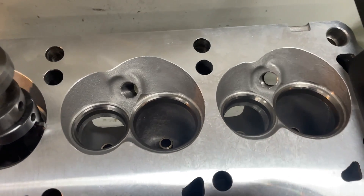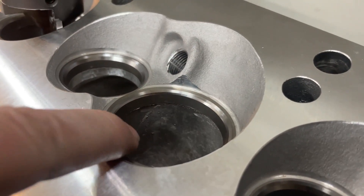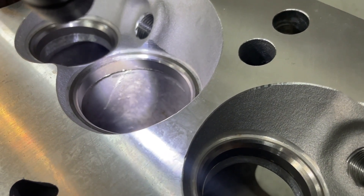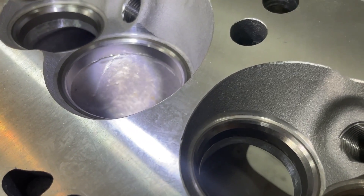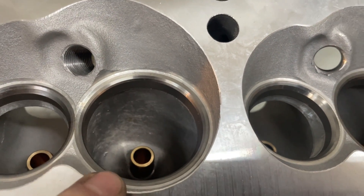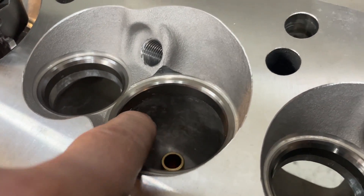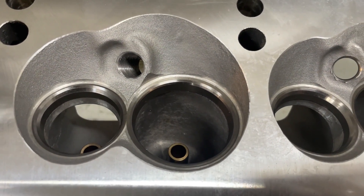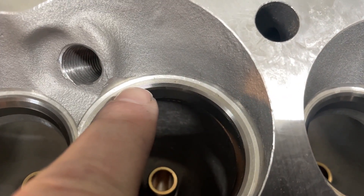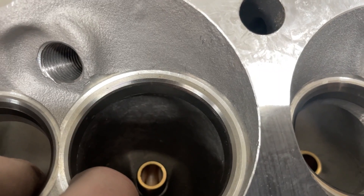I'd already flowed them — you can go back and look at that video — but the distance underneath the seats, because there's an overhang: you can see how the seat overhangs the bowl. That's not good for flow at all. These have a 202 intake valve, and if I just did a valve job it's not going to fix that. So I measured underneath where that seat was to figure out what valve might get a decent throat and get rid of that lip. 208 is about it. The seat material is wide enough to cut up to a 209, maybe 210, but I'm going to cut with a 208 intake valve.